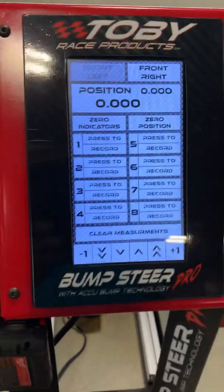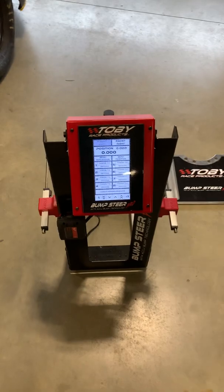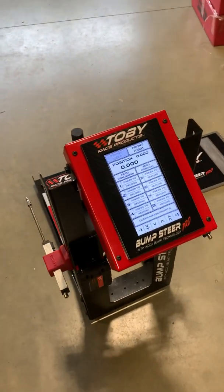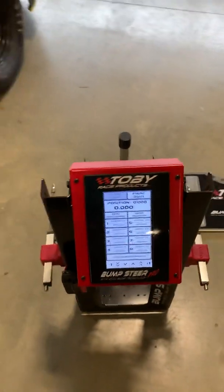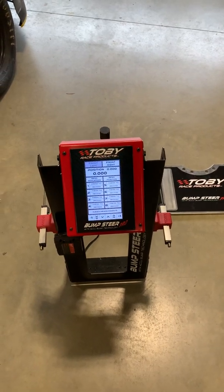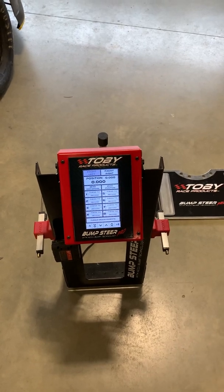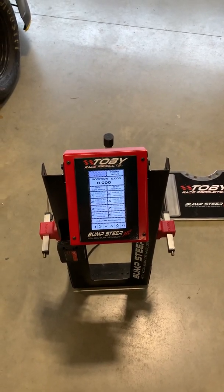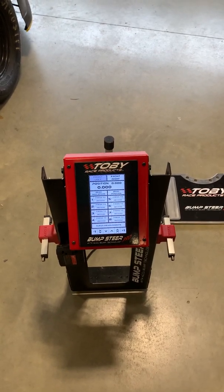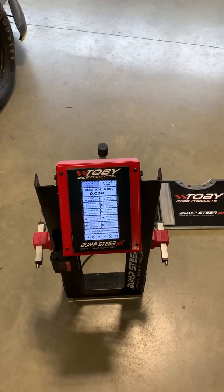That's kind of how it works — really simple, saves a lot of time with your bump steer process. This monitor does swivel up and down too, so depending on whether you want to sit in a chair next to the car or just stand up. It'll cut down on your bump steer and it's way more accurate — instead of using a pump jack and not getting it to the right location, now we can get it back to the exact location within a thousandth of an inch. Our indicators actually read eight decimal places out, and we've done it down to three decimal places, so those indicators are extremely accurate. Now you can get faster, more accurate bump readings in your car.